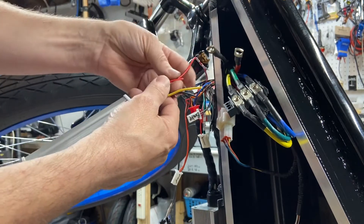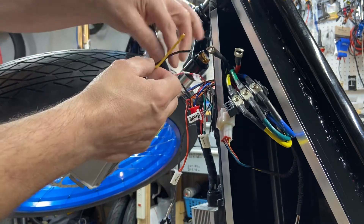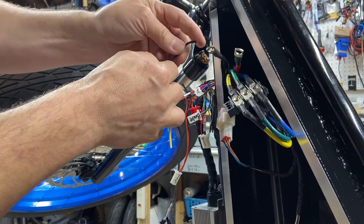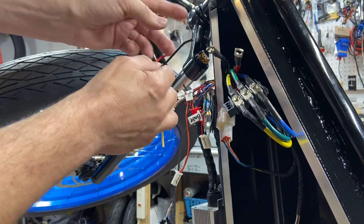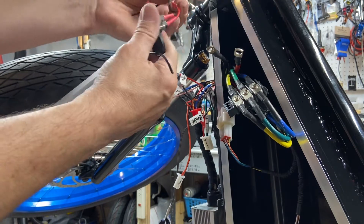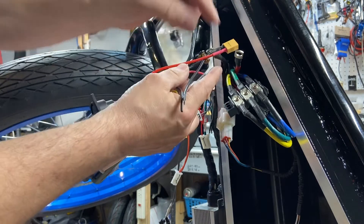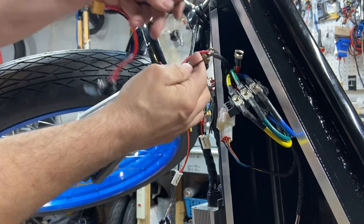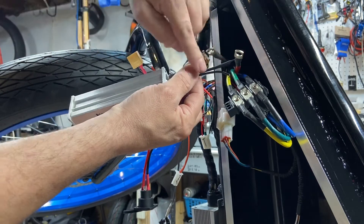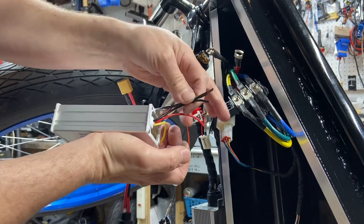Your black wire is shared for your full volts and your DC lights and whatnot. This is your charger plug — this also goes into your battery. I spliced an extra black wire so I can share it to the DC box. I'm also going to run two more connectors for DC 12 volts for lights or accessories.